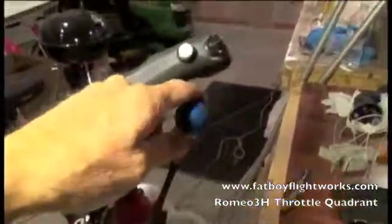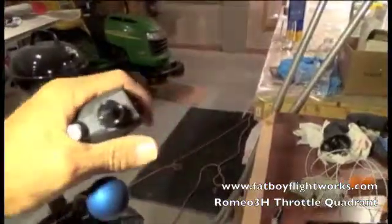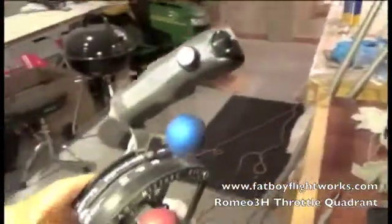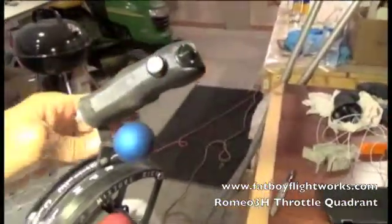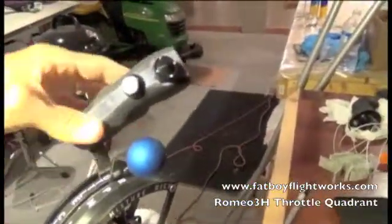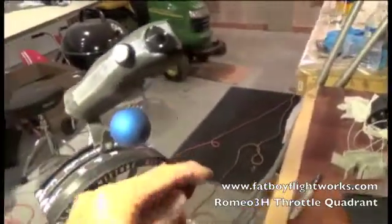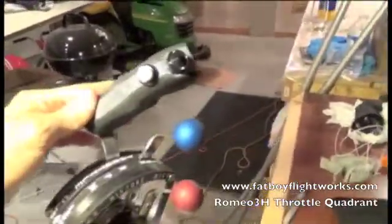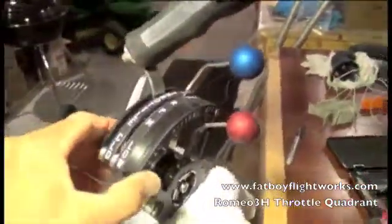But if you want to go up a little bit higher, maybe like another 3 inches, now of course your panel might come into play depending on where you're setting your quadrant. So there's a couple variables, and we'll give you lots of height to play with the levers. You can chop them back down and then bend them accordingly, so you've got plenty of room to play with. And that just depends on your particular setup, where exactly that quadrant's riding along the side.